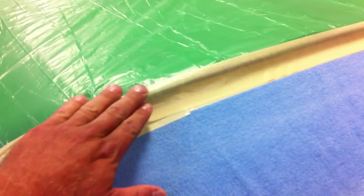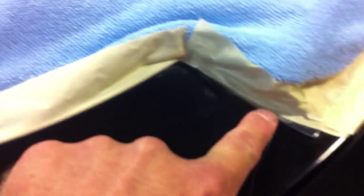A lot of times when I see someone that's buffed out a car, one of the first things I'll do — especially if it's a classic — is look at the fresh air grill intake to see if they threw splatter everywhere, because it just makes the whole thing look ugly, and again it's almost impossible to get it out. This towel is large enough to start at the top of the windshield line, come all the way down, fold over the fresh air grill and over the wipers, then I open the hood, tuck it down, and tape it to the ledge of the firewall. So it's nice and neat, and all the paint is still exposed so we can get in and remove all those swirls and scratches.